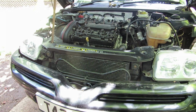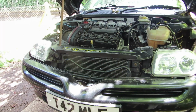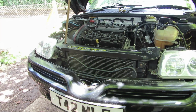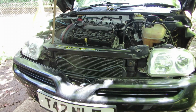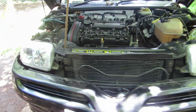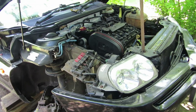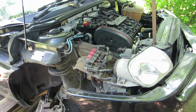There's two bolts that fix the steering rack to the subframe, and you have to release those bolts to get the subframe out. One came out reasonably easily and the other one just snapped off like a carrot when I applied a torque. It was totally seized in. They're not terribly large diameter bolts, I think about an M8, and a very fine thread, and they're quite long and they're prone to seizing in, so this is not unheard of.